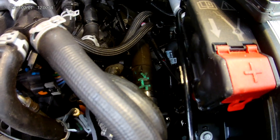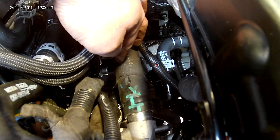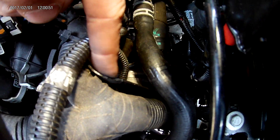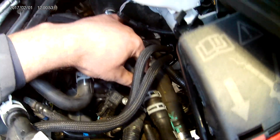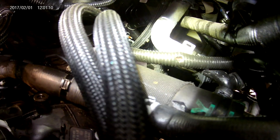I want to call this video the engineering disaster, because this is just small stuff but will cause you headaches down the road. First one being this coolant hose here — you can see the cut in it. What caused the problem? The heater hose has a small clip that held it in place right here. The clip came loose, fell down, and cut a hole in the coolant hose. While we were in the process of getting that one off, we also found this battery cable that feeds the fuse panel. You can see the hole worn through the loom, caused by the clamp right there.